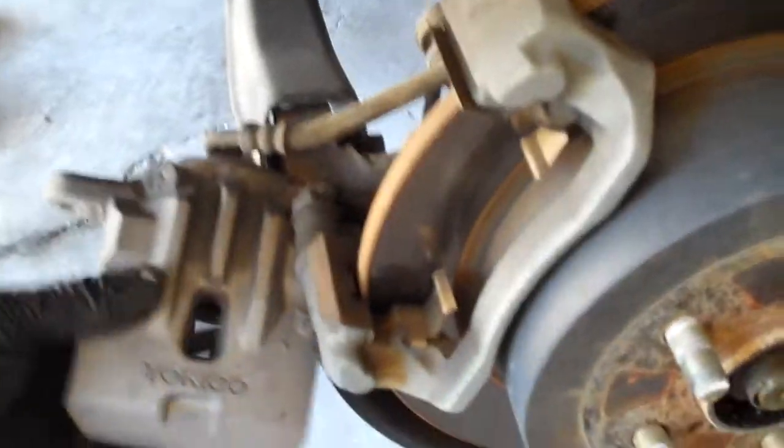Here's how I spread my brake calipers. I use my right hand when it's not holding the camera — I'll put the levers together and press it open like that. On these lightweight aluminum calipers on this Subaru, I don't worry about suspending the caliper. I'll just let it hang. It's not going to stress the hose because this thing seriously weighs nothing — it is just light as light.